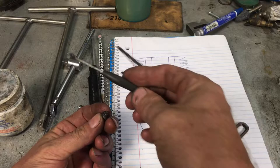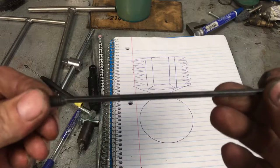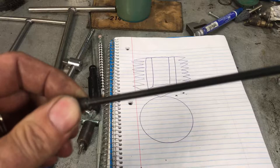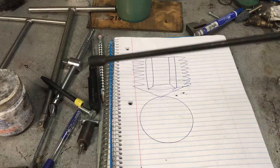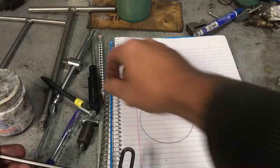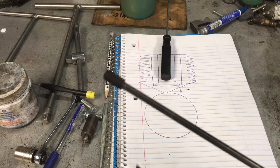Get a good amount of lapping compound into the bottom of the hole — now you have a puddle of it in there. Then take your allen wrench and wiggle it down that stripped hole. That right there will grip a set screw that's stripped out unbelievably tight — it's like solidly attached, like it's glued on there. Think of it like liquid sandpaper: put it on the bottom of the hole, wiggle and press the tool in, and it's stuck with a sandpaper gasket gripping the inside.